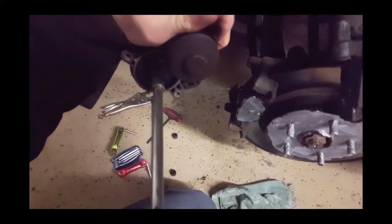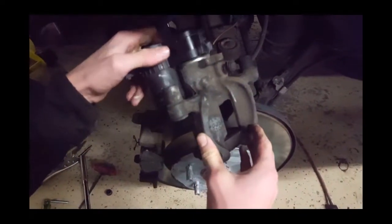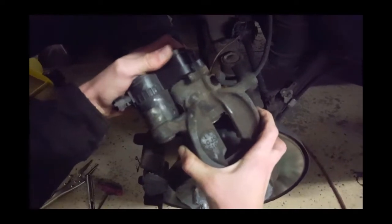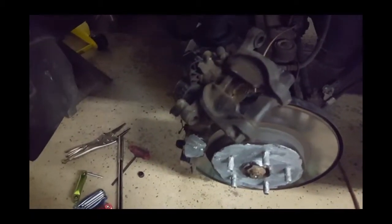Grease where the shaft enters the gears and motor, then reinstall the assembly. Put the two allen heads back on and torque them down just snug — they're not holding much load. Make sure to anti-seize all the hardware, especially those two small allen heads used to hold on the electronic motor, because they're really small and can get badly affected by corrosion.